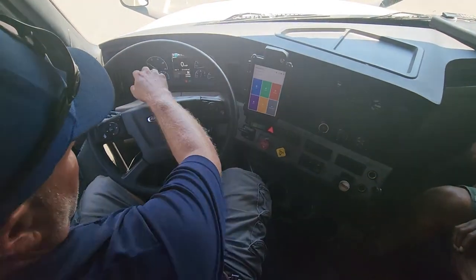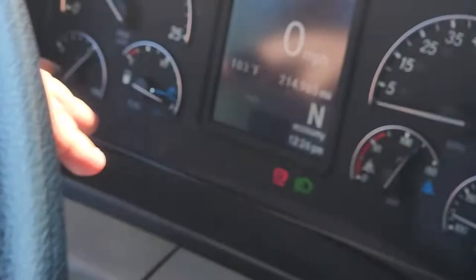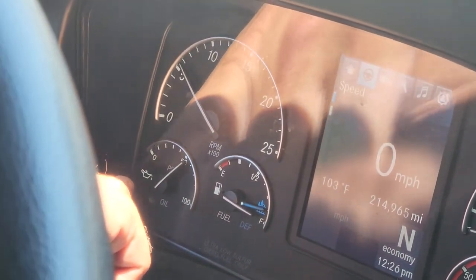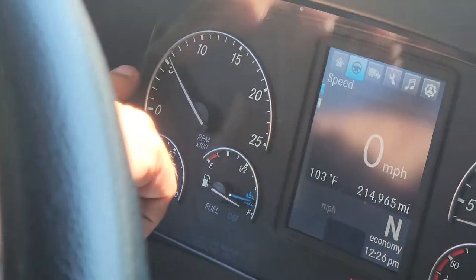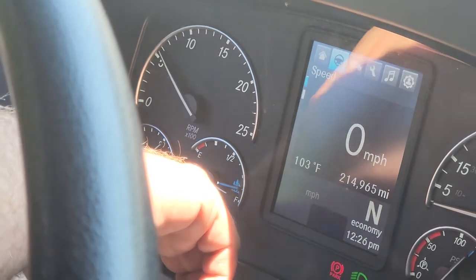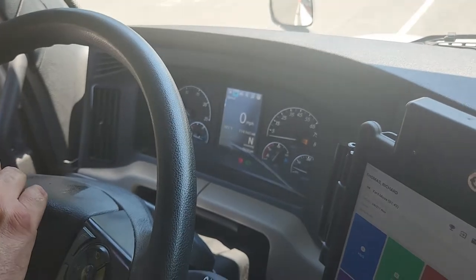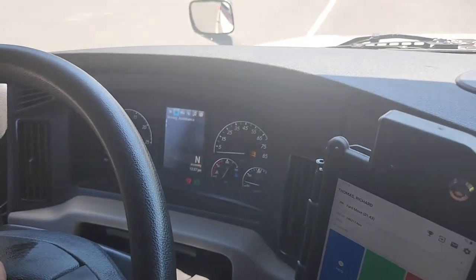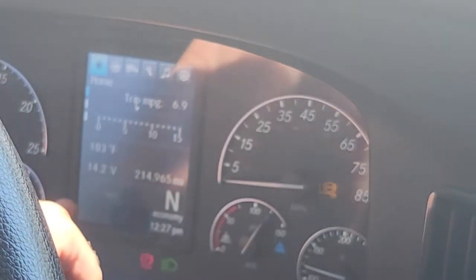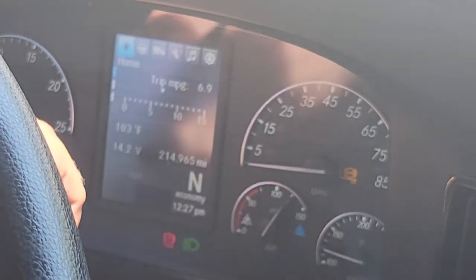Gauges — I'm going to sweep left to right, bundling everything together. My oil pressure gauge is rising to the normal operating range as the engine warms. Both my tachometer and speedometer worked on my last trip. I have enough fuel for my trip. My voltmeter — the only digital gauge — should read between 12 and 14 volts, meaning my alternator is charging properly.